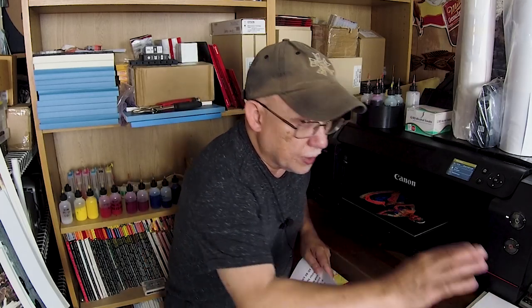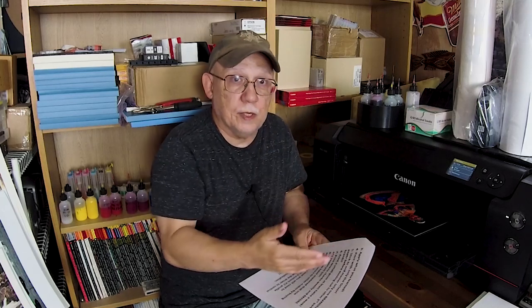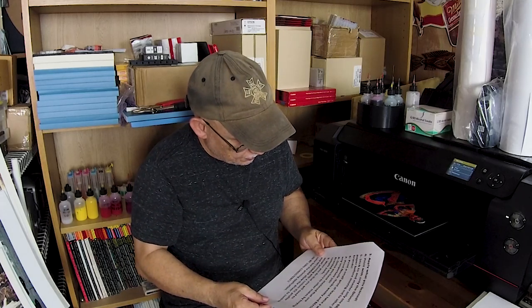Don't get carried away buying all different types of paper — test them via sample packs first. Once you go to a third-party paper made by another manufacturer, you can no longer print with the driver alone, because ICM mode only links you to profiles made for your printer's designated papers. You'll need to download their ICC profiles, which are made for your specific printer model and those specific papers — and for OEM ink only. If you're thinking about third-party inks at this point, those profiles are not going to work for you.